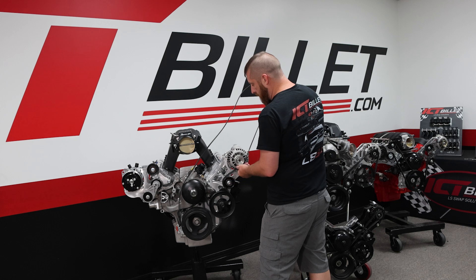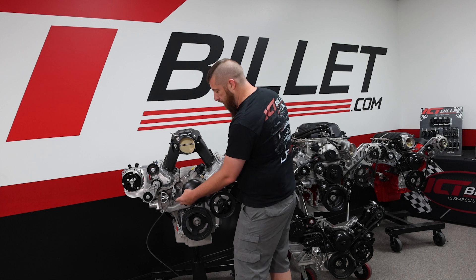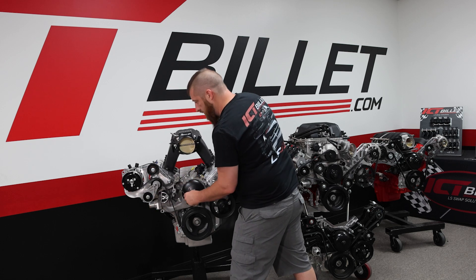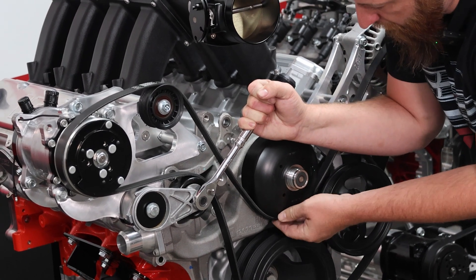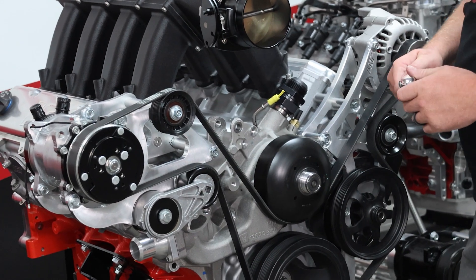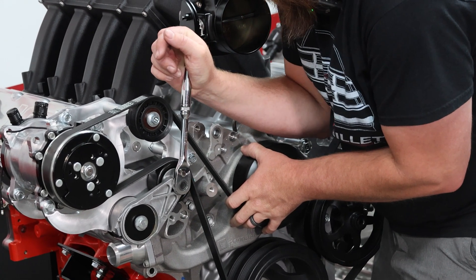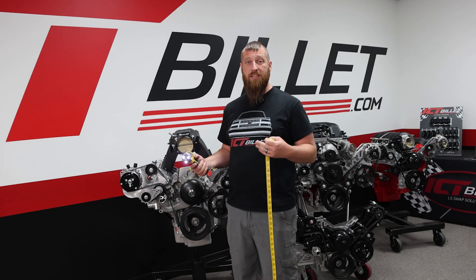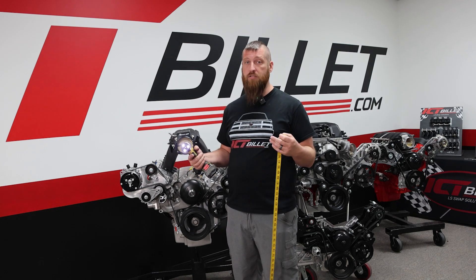One thing I will say is you always want to put your belt on your water pump last. It's the biggest smooth pulley and it makes it the easiest. Sometimes I'll just kind of put it right on the bottom of this thing to mimic where it's going to be, get everything else squared away. So I'm ready to put it all the way on — put my ratchet on my tensioner, give it a good tug, max it out, put it around the water pump. Perfect. You see our tensioner went back to the middle of its sweep. To make sure it's the right length of belt, I'll put this on the other way and see if I can max that tensioner out easily. If you can max it out easily, it's too long — you do not want that. This method will just get you a good starting point for your length of belt. You might have to try one, maybe two belt lengths, but this will get you really close.